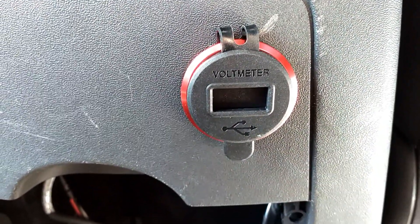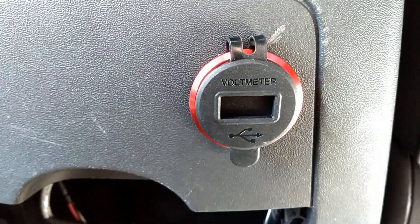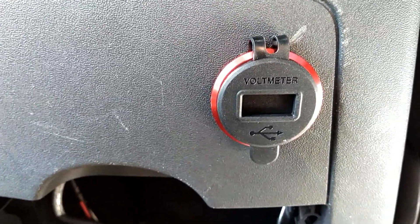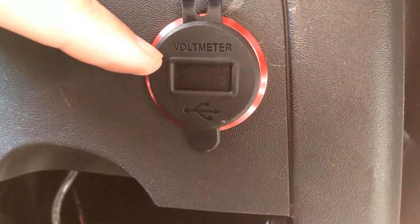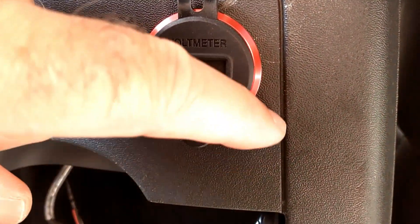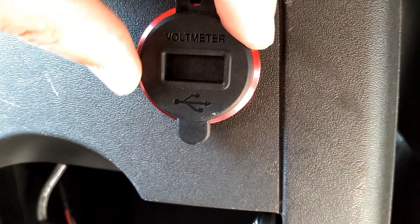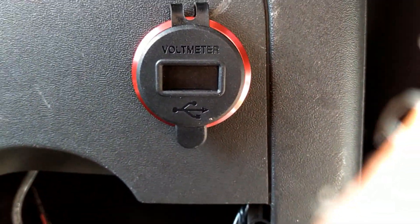You need to be very careful that your rear depth is okay. Mine actually is very, very tight — the wiring is actually up against the console and gave me a couple seconds of angst. So if you're thinking about installing one of these, I'd probably recommend bringing the hole down about a half to three-quarter inch and have it more down in this area instead of where I ended up, just to give yourself a little extra space. Everything worked out okay — it is in, the nut's tightened, and I'm looking forward to firing this up.